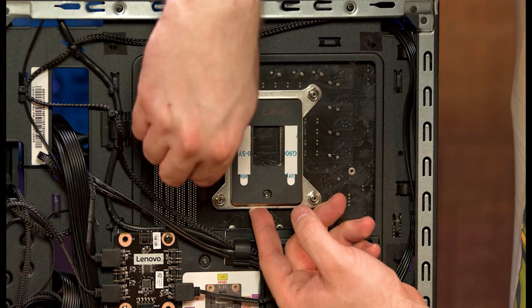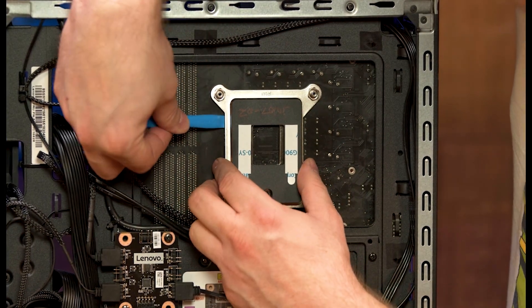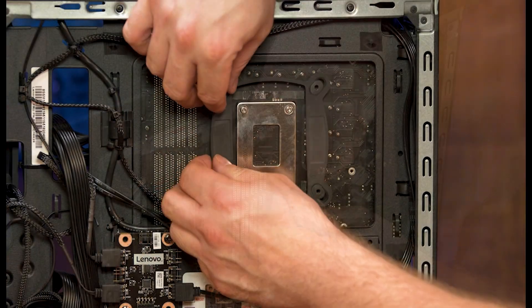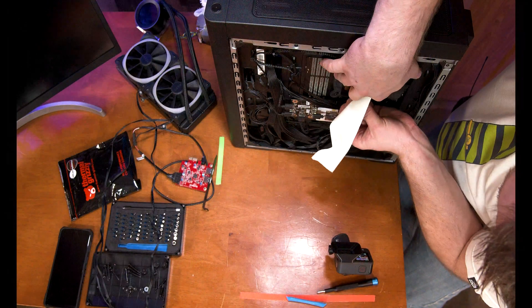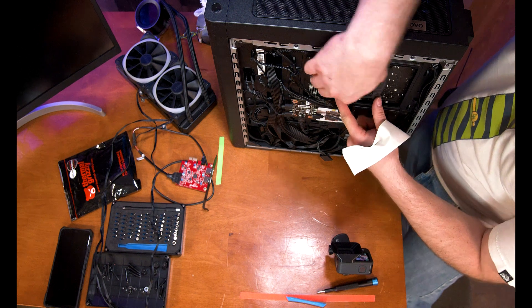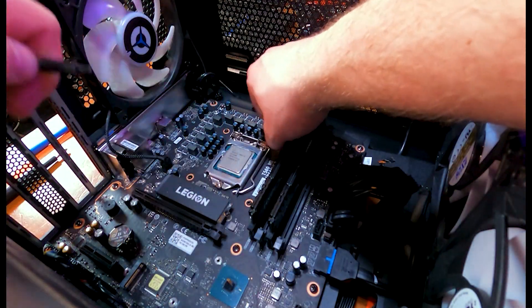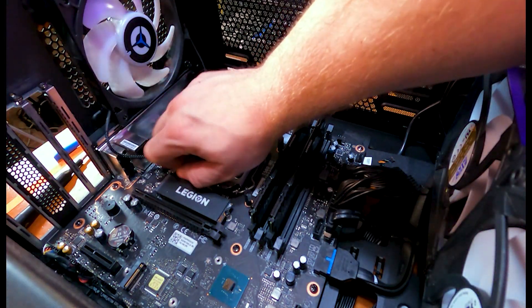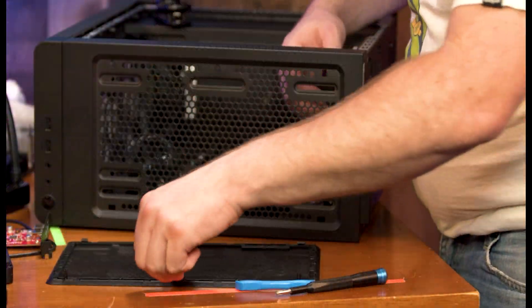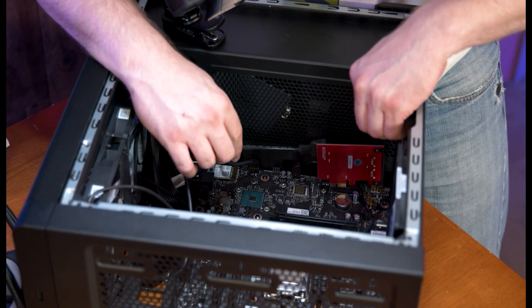Even after taking it off four or five times, this backplate is still kind of a beast to get off and does take a little force to pop off. NZXT includes a bracket with little movable heads inside. A little tip: stick a piece of duct tape or gaff tape to hold the bracket in place, especially if you're only one person doing the install — you really don't have three hands and it's hard to hold it on the other side while doing the nuts. Now I'm going to start putting down the actual standoff nuts to hold the heatsink — just get them snug, they'll stop on their own. Then pop the three tabs up at the top to let the screen pop off, which allows you to put your screws in for the 240mm AIO.